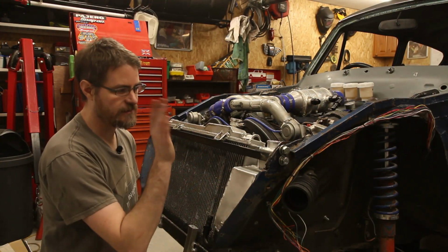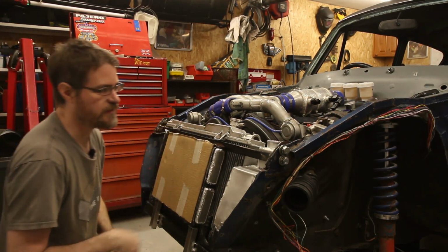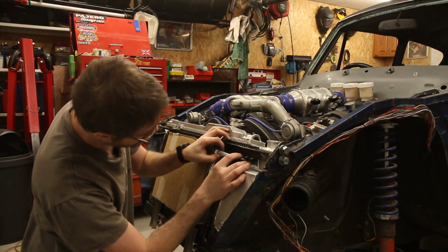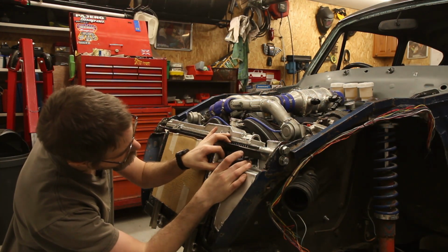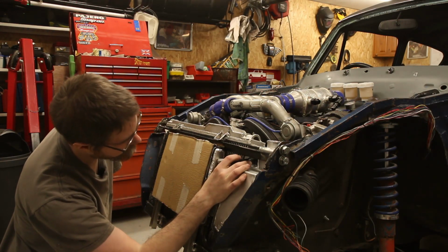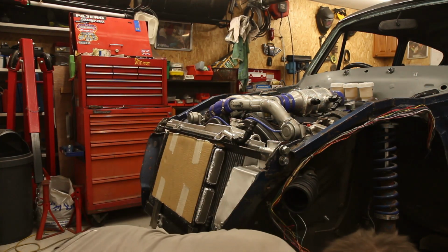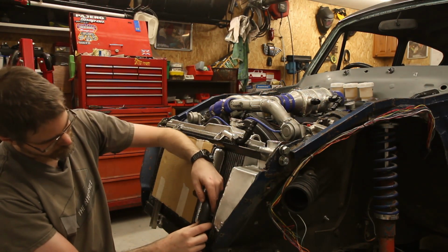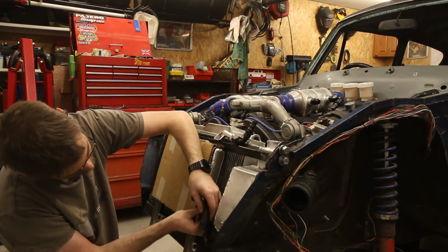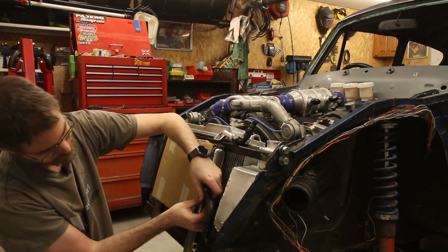So the main consideration then is where this is going to go through here. Because obviously it needs to hook into this top tank here, and this is quite high up here. And I could put a bit of an angle on it, which will allow me to bring the radiator down. So that's a possibility. And of course the other thing is this one here. But again, with a small amount sliced off of that elbow, I could possibly bring that down by a little bit as well.